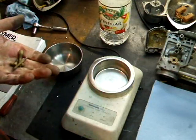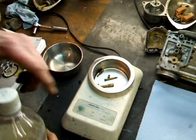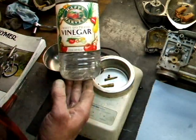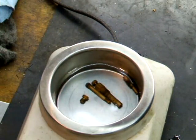To start, what I do is I put my dirty jets — only the brass ones — in the ultrasonic cleaner. Now this is just a small jewelry ultrasonic cleaner. Then I use white distilled vinegar. In goes the vinegar until the jets are covered.